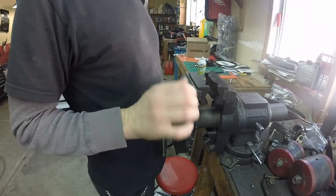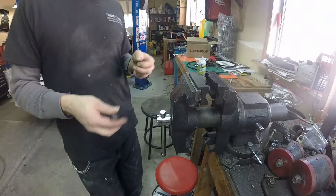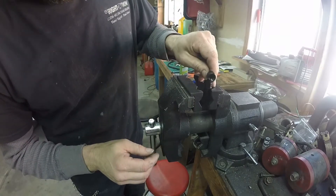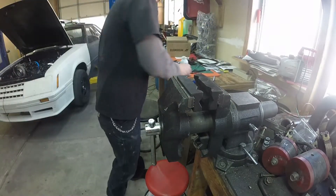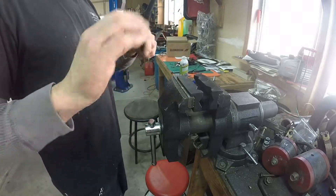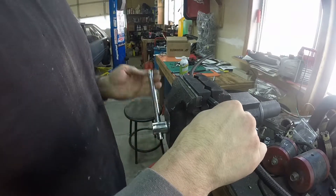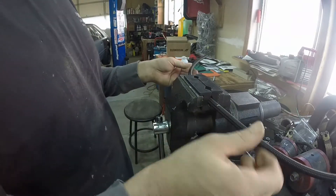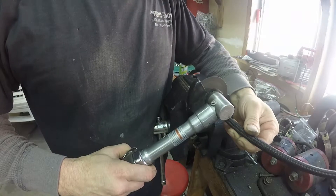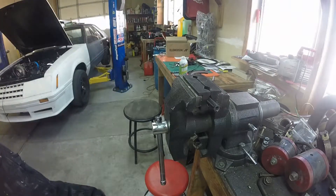These hose holder tools you can buy off Summit Racing. They're kind of a holder — you hold the hose in them just like that when you're doing the fitting. You can also clamp from the side. What I like to do is take the hose, stick it right in here, clamp down on it — works for 6 AN and 10 AN and more — then take it nice and slow for a good clean end.